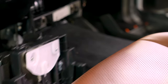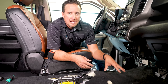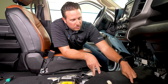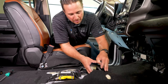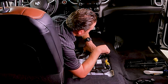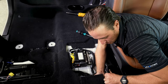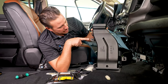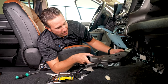Next, underneath the carpet there's a floor AC vent — this was for the rear vents of the center seat. We want to go ahead and remove it. In the carpet there are push pins: one about here and one over there. You need to lift up on the plastic to release it from those pins. You can use a regular screwdriver to pry it up, then slide it out of the guides.